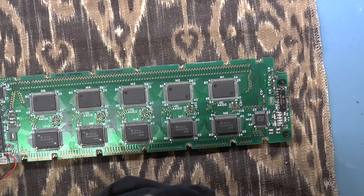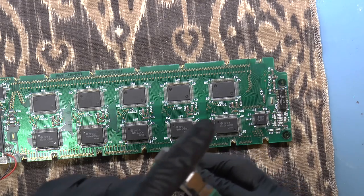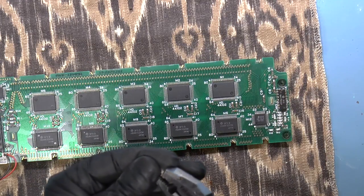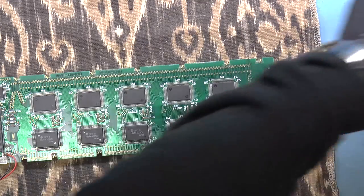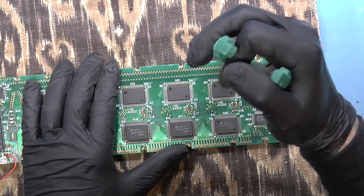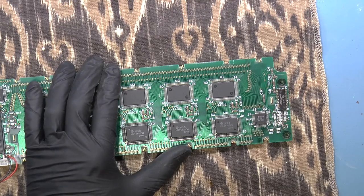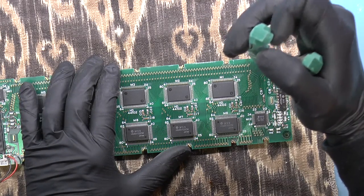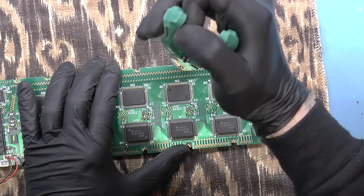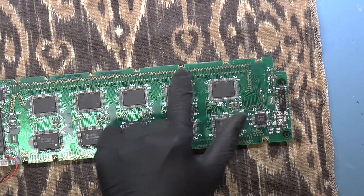This is cool because usually pliers just have these lines running this way, but this one has them running this way in the middle so that you could actually grip the head of a screw and turn it without too much trouble. So I think this is probably a good tool to use to turn these tabs. It seems to be working pretty well. I don't want to turn them very fast. And I also don't want to scrape the PCB because these vias are awfully close.